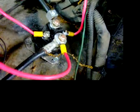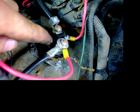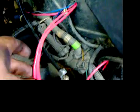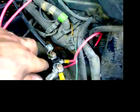This is a starter solenoid switch from an old Ford — like a 351 or a Ford 460, something like that. This terminal here is the one that says S. This one here is just a dead wire I had on there, doing nothing. All you need is the one that says S. You bring your power to this terminal, then bring this wire into your cab through the firewall to one side of the switch. The other side of the switch connects to S — S for switch.